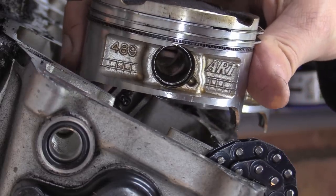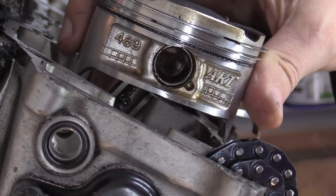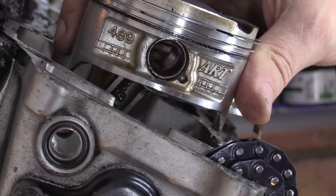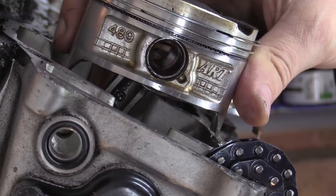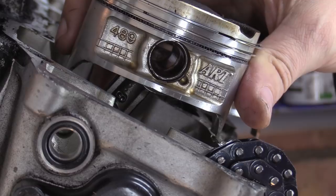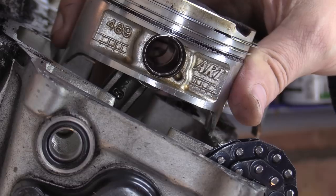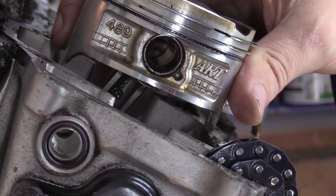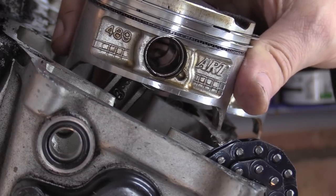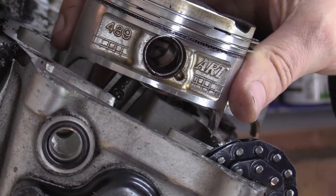You can see at the bottom there near the tang. Now don't put the tang over the hole. The other thing is you'll see that the rod is a floating rod — this is a fully floating rod. A lot of V8 engines sometimes have semi-floating rods where the wrist pin gudgeon pin is either forced into the piston or pressed into the rod. Usually it's press-fit into the steel rod, and the piston is floating, but you can have it both ways.